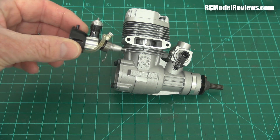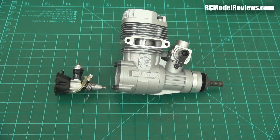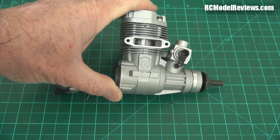50 times more displacement - that's the range. And of course you can get much bigger glow motors. Not so popular these days because gasoline motors have taken over. Used to be you could get Super Tiger motors up to 30cc, up to 50cc. A 50cc glow motor. Now anything above 10cc is usually going to be gas - spark ignition with gas.